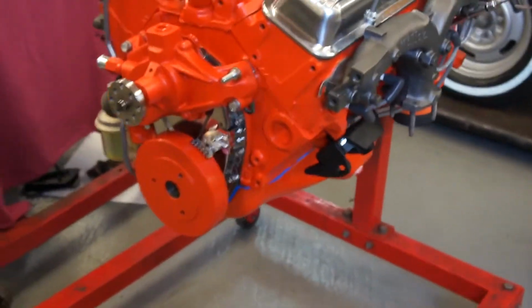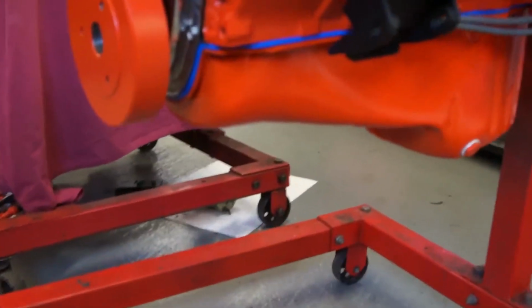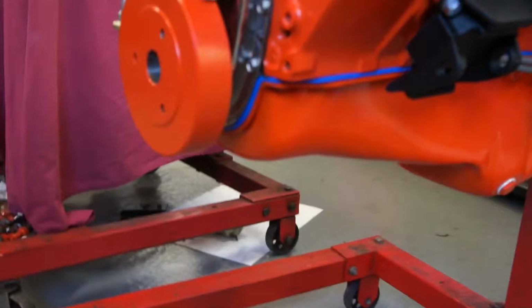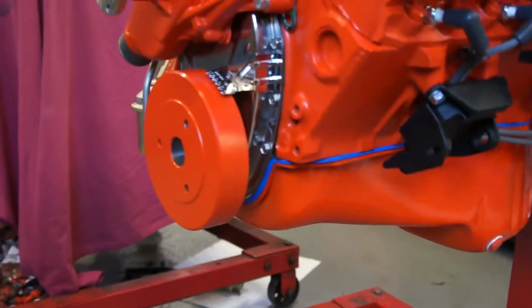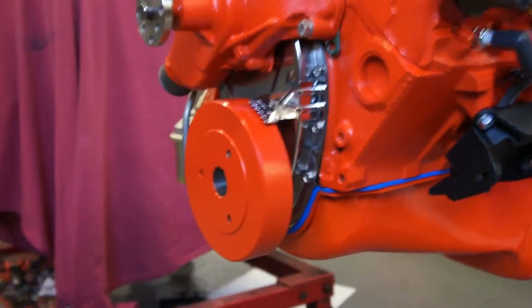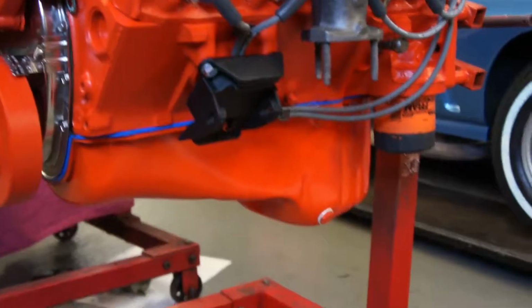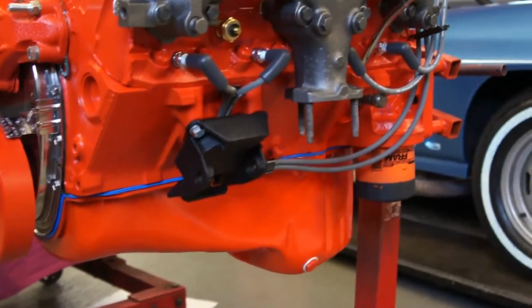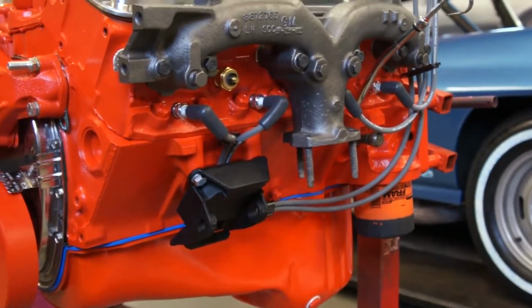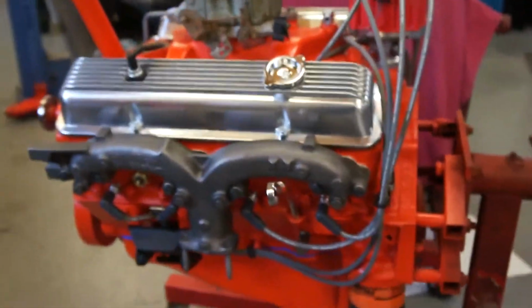We've replaced that rusty chrome oil pan with a new orange painted one and a nice silicone one-piece oil pan gasket in there. I've had the timing cover off and given that a clean and put a new front oil seal in, new gaskets on there, new water pump, new engine mounts, obviously oil and filter. They're your original manifolds, cleaned and treated with that Calyx manifold dressing that we use. New plug leads on, routed nicely and properly like they should be, and that all looks very nice.